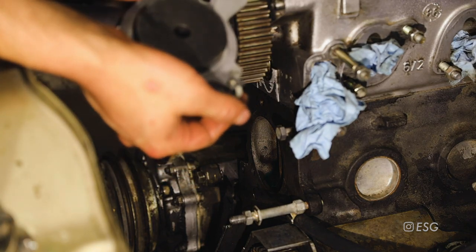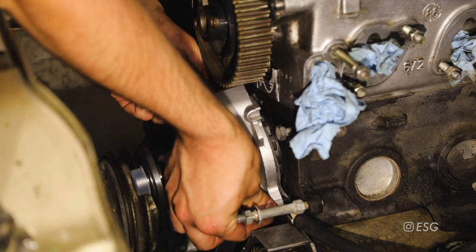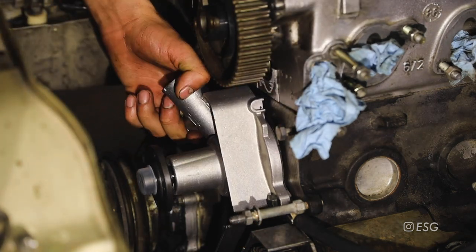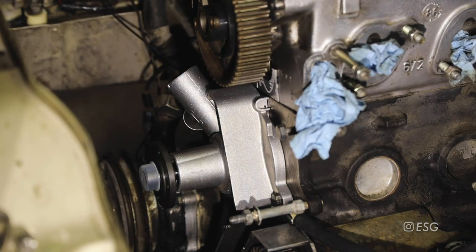Now it's time to install the water pump. Just make sure you put on your gasket the right way - it only goes on one way so they're pretty user-friendly. Get your gasket on there and get one bolt started so the gasket is held in place. I'm going to torque the bolts for the water pump as well. The torque spec is 22 Nm or 16 foot-pounds. It might be different for other model E30s so I'll include a link in the description where you can find torque specs for most bolts on the M20 driveline.